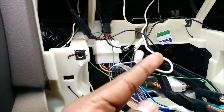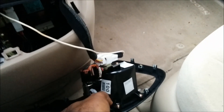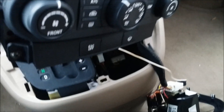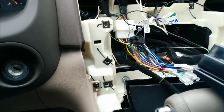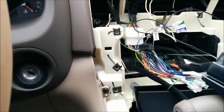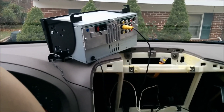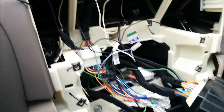That wire also runs all the way along with the RCA wire — they both go together. I have one more white wire right down here, and I ran it all the way to the cigarette lighter positive because that gives the ACC signal. I'm taking that ACC accessory 12-volt power supply from the cigarette lighter all the way back to the rear view camera to power the camera itself. That way I can actually see what's going on behind me while driving, even without being in reverse. So instead of hooking it up to the reverse light, I'm hooking it up to the cigarette lighter — that's it for all the wiring behind the dash.